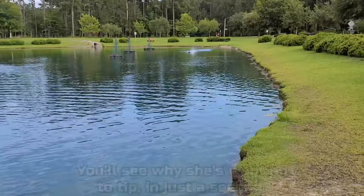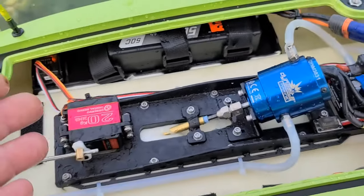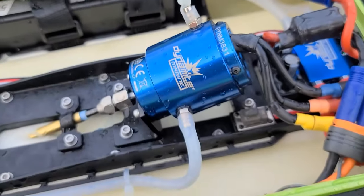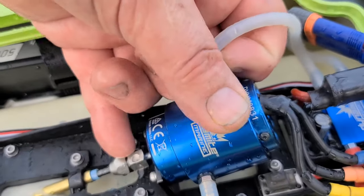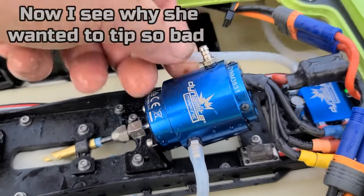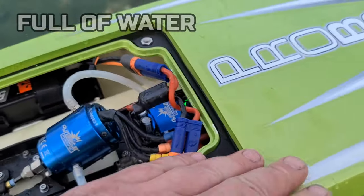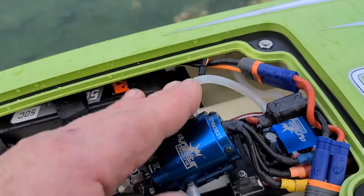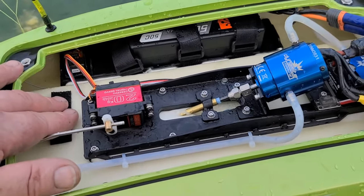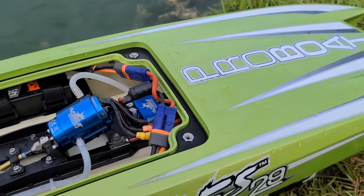That's the 50c packs - that's not bad. Why is there so much freaking water in my boat? Pouring water into my boat. I had water in my boat both times it flipped and I just thought it was from flipping, but it wasn't - it was from the freaking water cooling line right here. I had her laying on her back while I was blueprinting the boat and hitting on that cooling tube. So it's my fault. Let me put the 100c packs in, throw the GPS in it, and see what she'll do. My average speed in this pond is about 58-60 on a good pass.